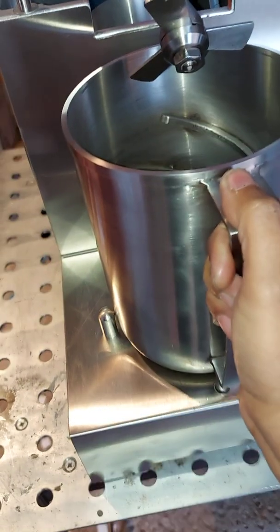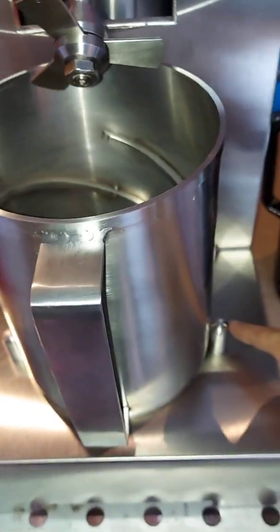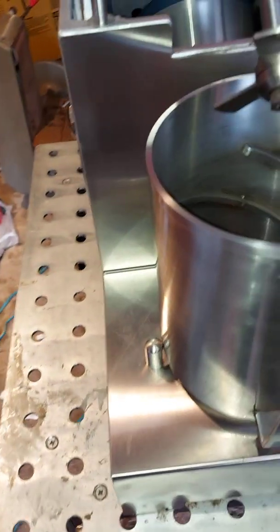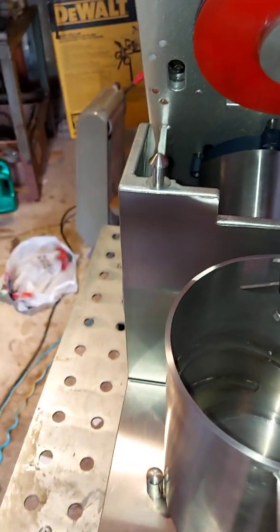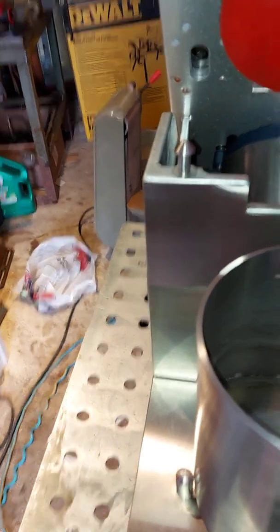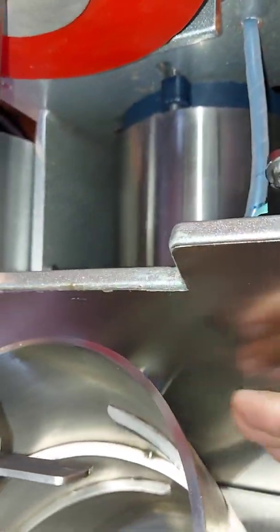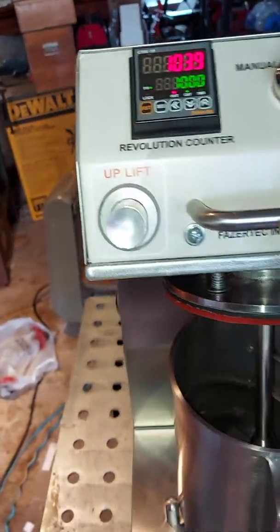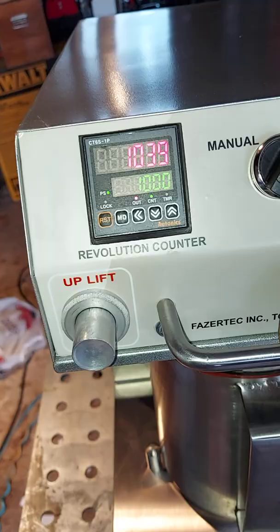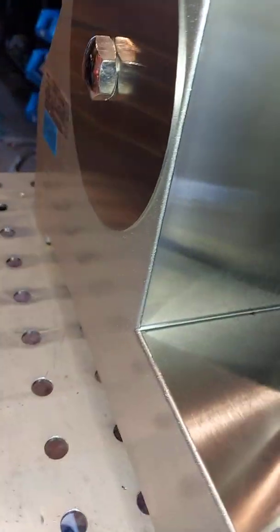This is how you place the jar inside onto the base. We have eccentric pins here by which the jar is centered. You place the jar and keep it at the back side so that the switch is pressed properly, then bring the upper part slowly down and gently press it so that it seals all sides of the jar.